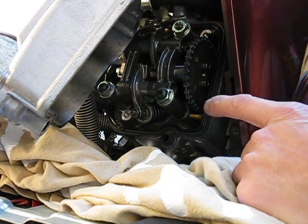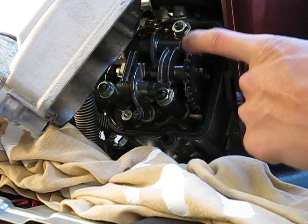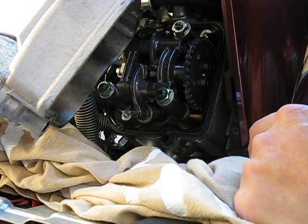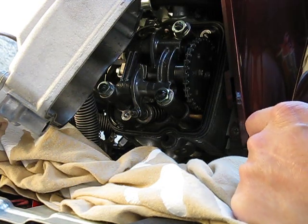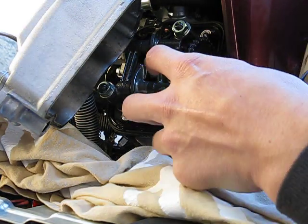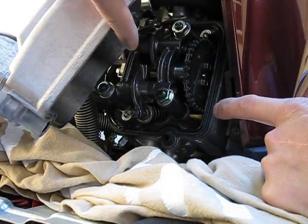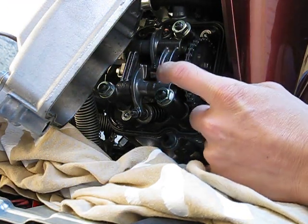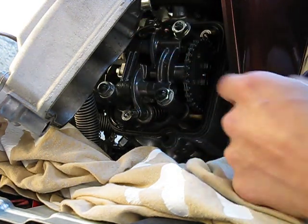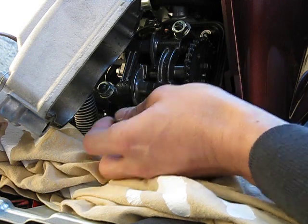What I usually do is just keep spinning the variator and watch where the cam lobe comes up and activates the exhaust or intake — you can see the rocker arm move. I set it so that both cam lobes are facing towards the piston, so I know both cams are in the most slack position.